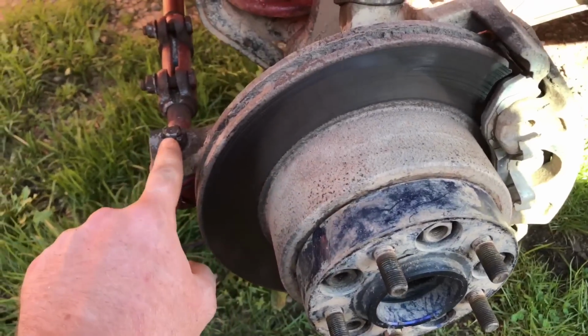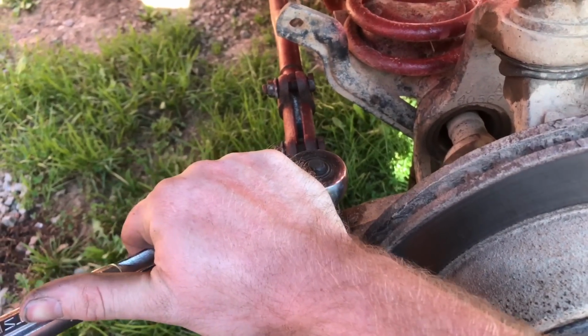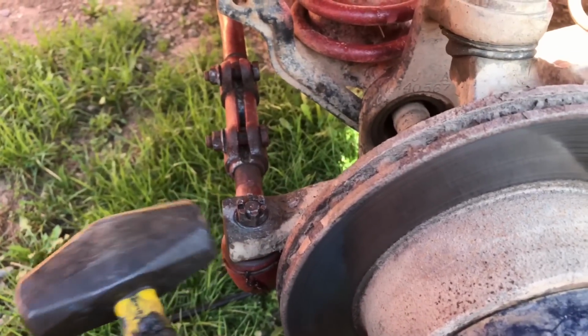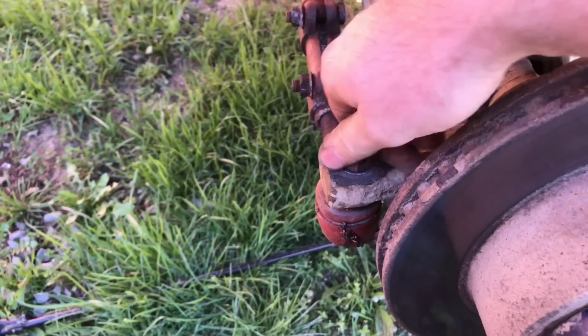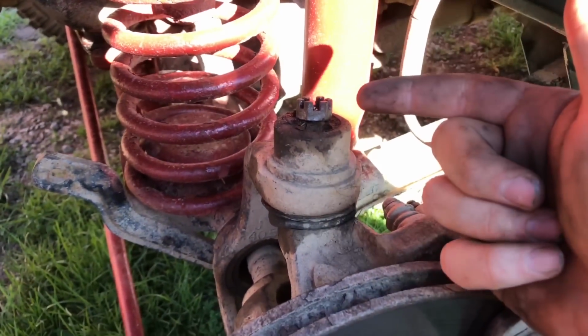All right, now you've got your wheel off. You can go ahead and take this nut off. Let's get a 3/4. Go ahead and pop it loose. Lay your nut up here so you can lose it in about 5 minutes, and knock yourself to death for it. Stick the nut back on first, then hit it. Just give it a good couple taps. Hold it. And it drops right out. Then put your nut back up here so you can lose it.